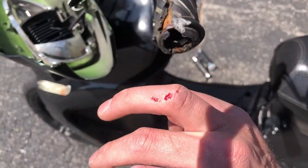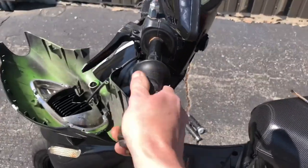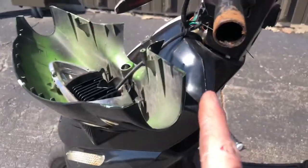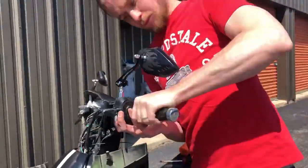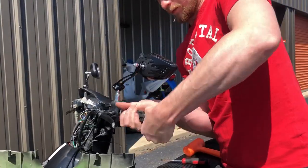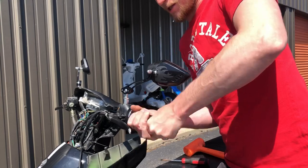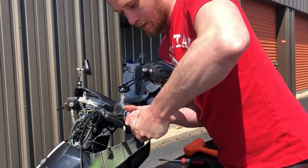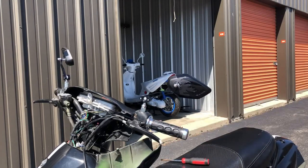After a little bit of sweat and blood — I literally just wrecked my finger twisting this grip off. So literally what I did is I just hacksawed this thing in half. I cut it down the middle to get it loose and get it going. Then I took my flathead and I dug it underneath the grip on the handlebar and just pried the sucker off. There it is — one done. I'm screwing the new one on right now and it's working. Oh, we're so close. There she is. One done.